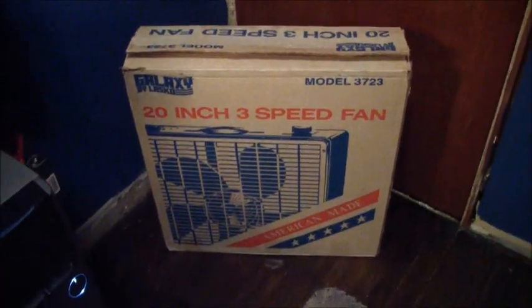That was a shame, but it's okay — I had some extras, so it wasn't the end of the world. That one had a burnt-out motor, so I replaced it. The motor and blades from the one that was originally in this box went into that case, because that case was near mint. I cleaned everything up, oiled the motor. The motor still had some dust in it. The feet are actually from a much newer one from the early 2000s with the flower petal blades, but it had the full-size Marco motor in it.